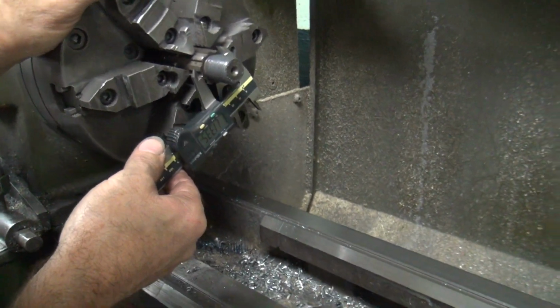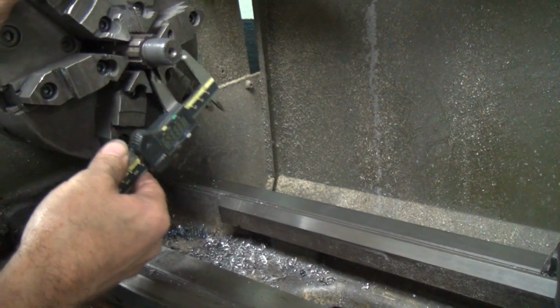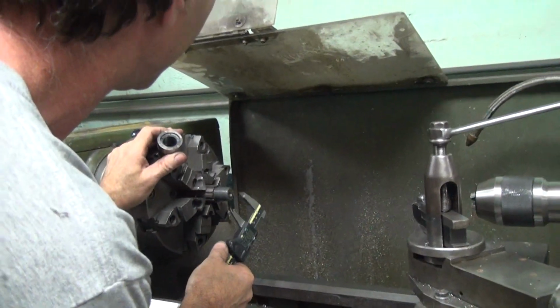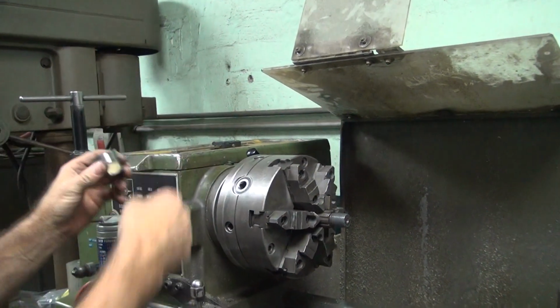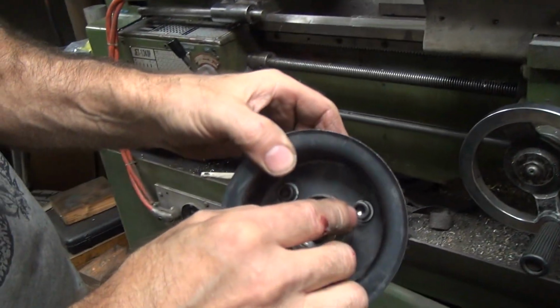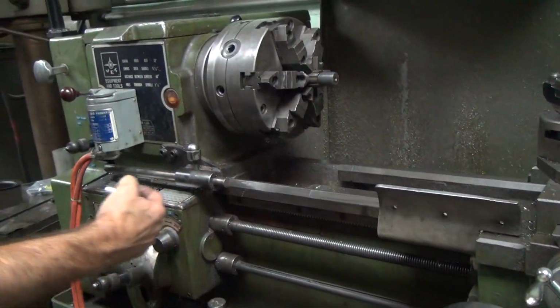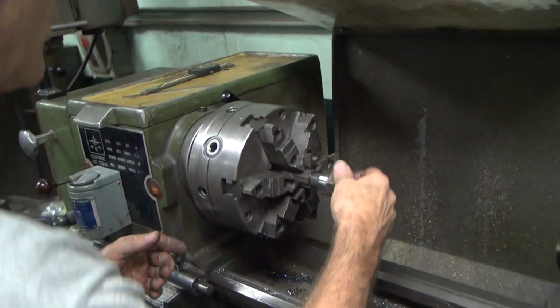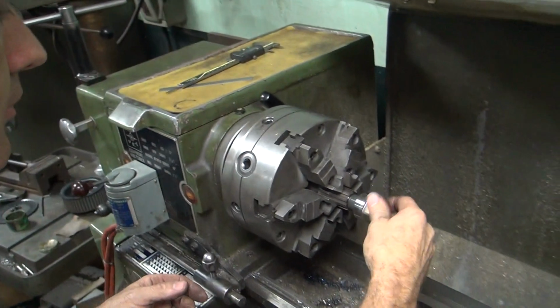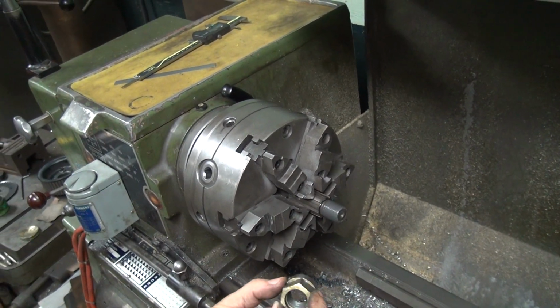Yeah, see, that's gonna be... It's not even going to push on the spline. It's going to push on the top part of that. So this is going to clear this spline. It's going to hit on that spline, only on that part there, which is fine. You know, it's undercut that much. So this can actually recess inside this nut, even though it doesn't need to, because it doesn't go in that far. The problem is it doesn't go very even. So that means this nut needs to go in there a lot deeper than what we're seeing, because it can still go in further.